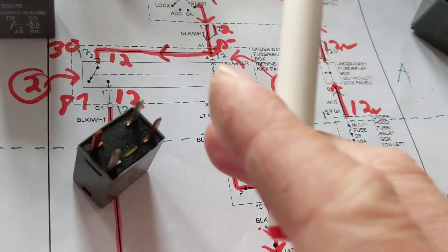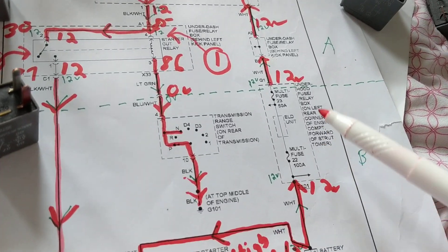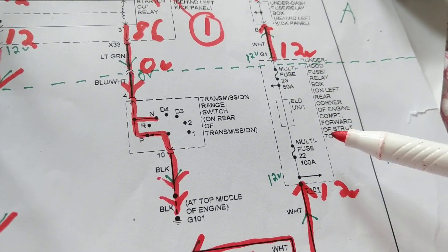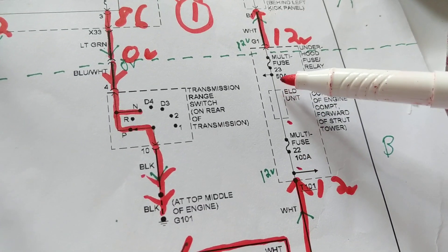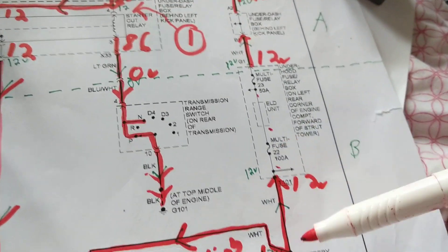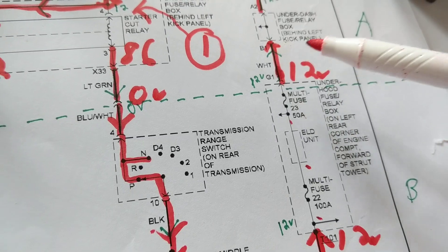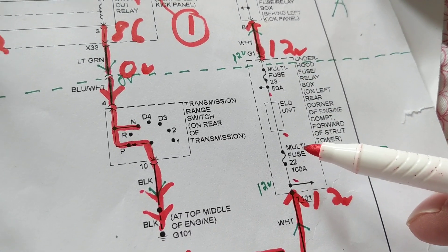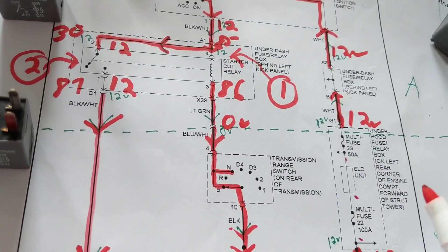Now let's say this is a starter circuit that we've been going through for Honda and all these models. They have a multi-fuse — two fuses common to each other. We have a terminal here that's common to another fuse, but this fuse is 50 amps and this fuse is 100 amps. The common line is over here, and the output is here — input from the battery, output of the multi-fuse is the white wire over here at G1. So again: multi-fuse, two fuses together with a common point. Now we want to jump the relay, but before we do such a thing we have to understand the circuit.